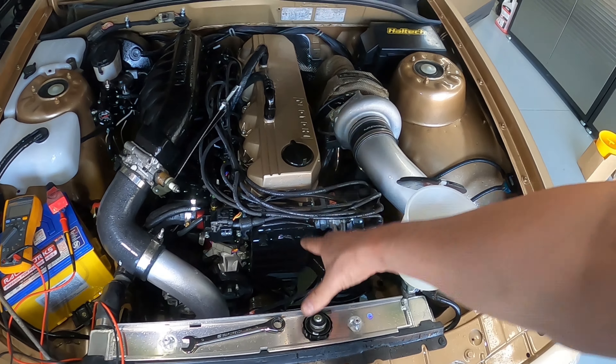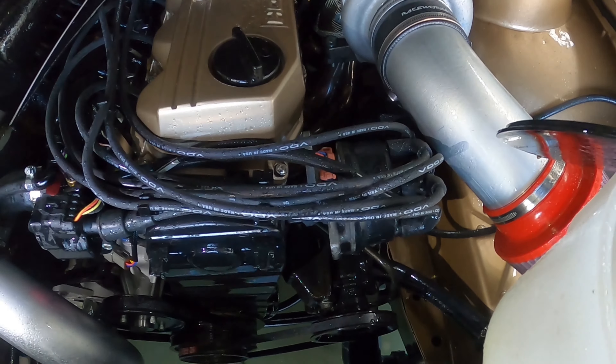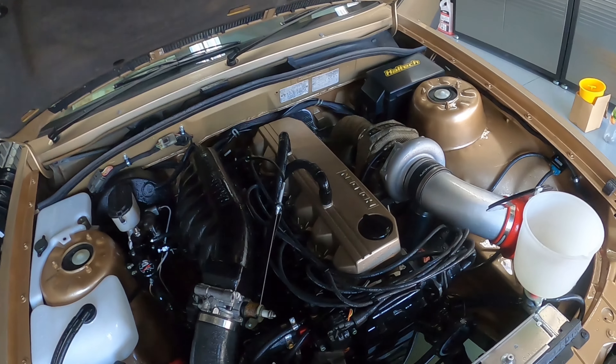After about five to ten minutes of having the car running, the oil pump let go. This was a billet oil pump from Speedmaster — billet alloy with 4340 chromoly gears. I thought it was an awesome upgrade since we all know RBs have some oiling issues. I put that in and it popped out a Welsh plug. Brand new and perfect, this plug just popped straight out. I phoned up the guys at Speedmaster Australia and they were awesome to deal with. They immediately sent me out another oil pump — exactly the same but with pins installed to make sure the Welsh plugs wouldn't fly out again.